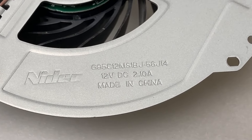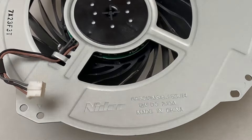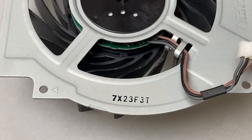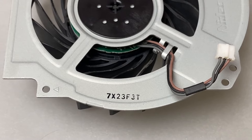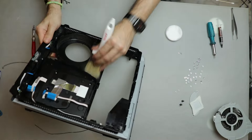This is the fan model number. Here you can see the arrow engraving that indicates where a screw should be placed on this plate. If you don't see the triangle shaped arrow, you should not install any screw there. This rule applies to all the plates and all the PlayStation consoles I have taken apart so far.